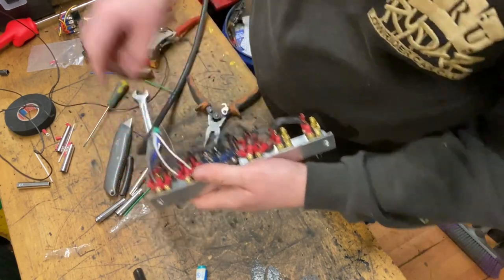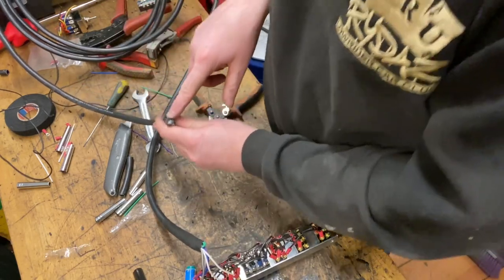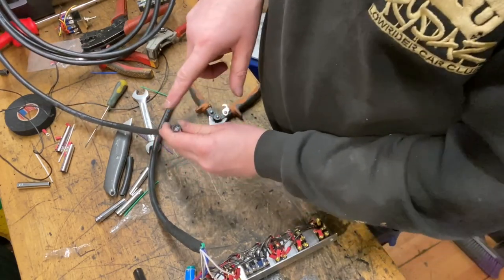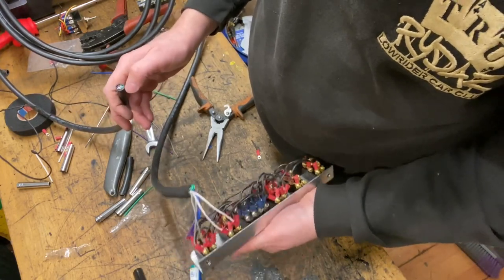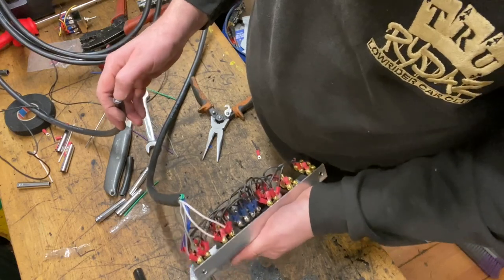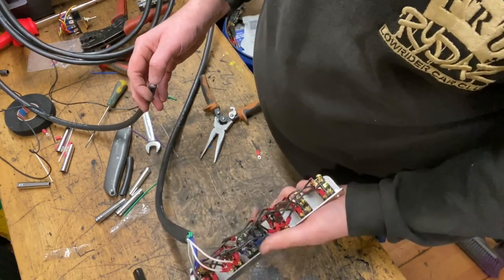You can also test it. You can get the other end of the cable and make sure that nothing's making a connection. And if you've got a multimeter with probes on it and a little sound alarm, you can hit the switch and put the multimeter across your 24 volt and the wire that you think it should be making a connection with, and the ones that it shouldn't be, and test all your switches to make sure it is actually wired up correctly.